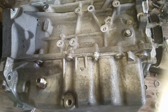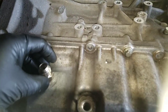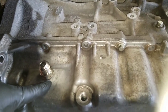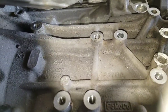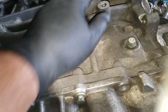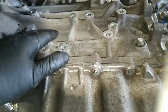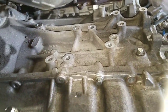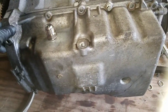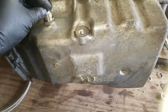I really don't mind if it blows up or not. The reason why we have to tap for oil return and oil feed is because these 2.5 blocks are NA — naturally aspirated. Usually the oil feed and return will be somewhere on this side of the block, but in this case we don't have one. I'm using the Mazda Speed 3 or Speed 6 oil pan and tapping into it.